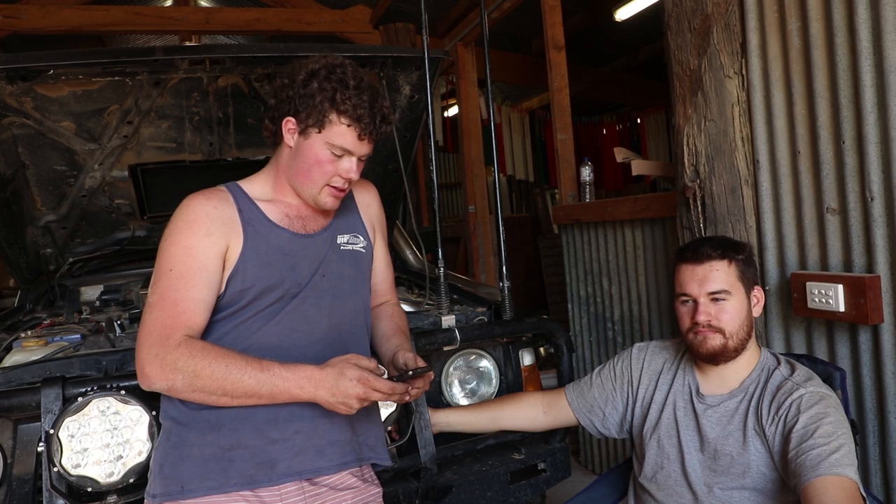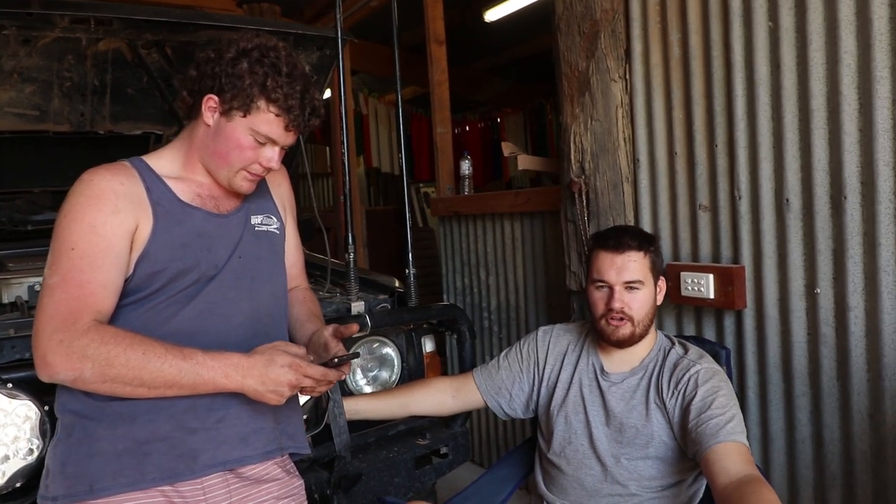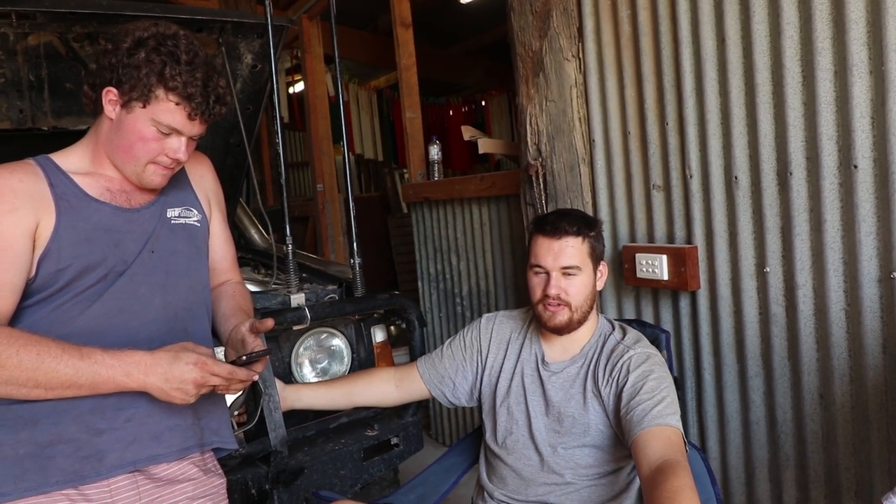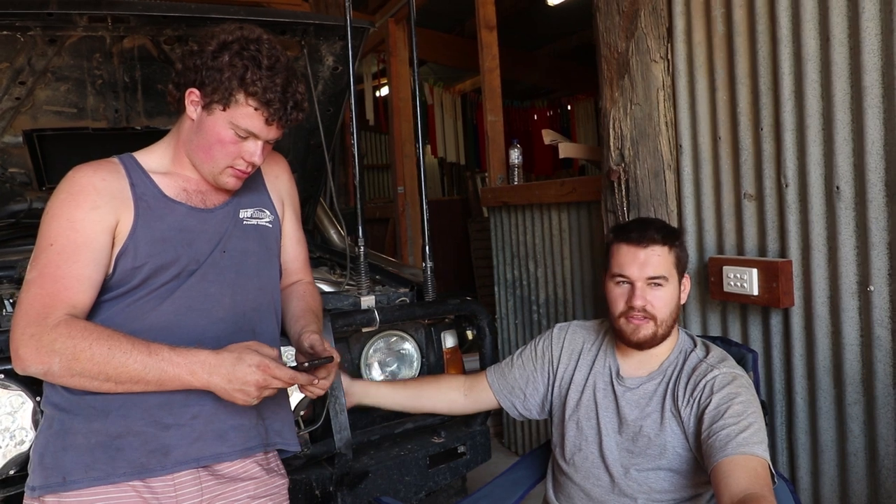If you did have something with a 12 mil pump on it, like a silver top or a silver top with an 11 mil pump, you could probably get to 30 pounds if you wanted to run a bleed valve in the line. But if you look at the people that do that — they put like 40 to 50 pounds into their GUs. If you take it to a professional dyno, they would turn that down — the optimal fuel ratio for it is like 20 to one.